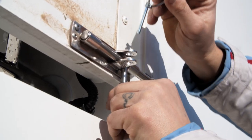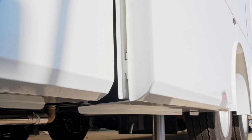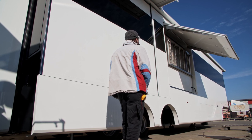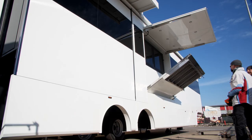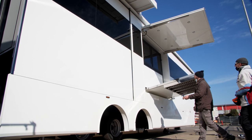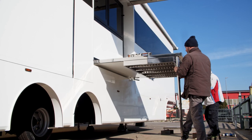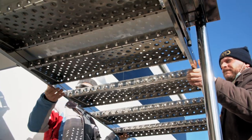Remove the safety locks from the balcony. Open the pull-out on the right. Use the remote control to open the balcony's roof until the end of the stroke. Open the balcony's floor — keep the lever pressed until the movement has been completed and wait some more seconds after the end of the process. Pull out the ladder and fix it using the knobs.